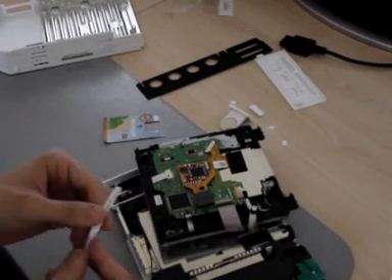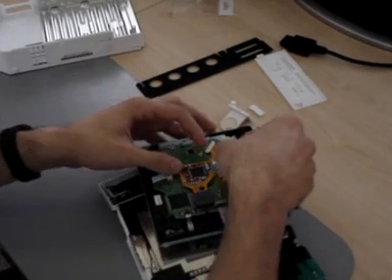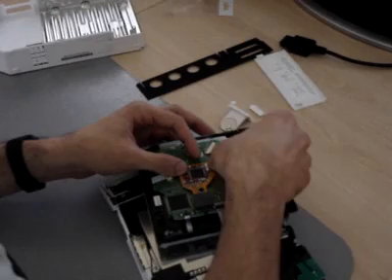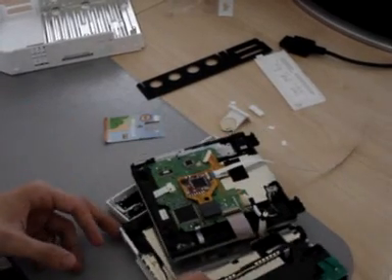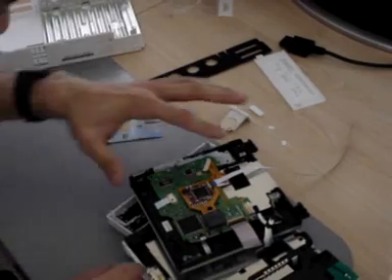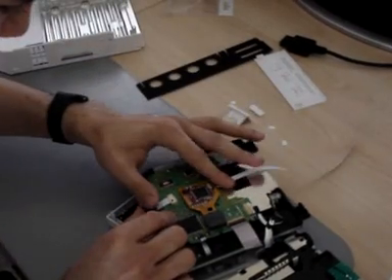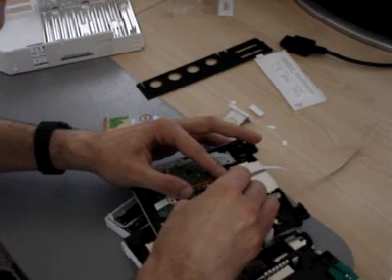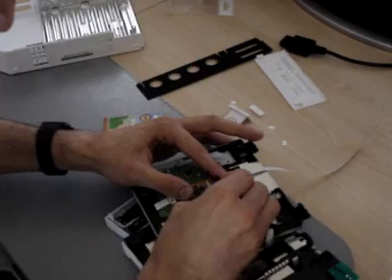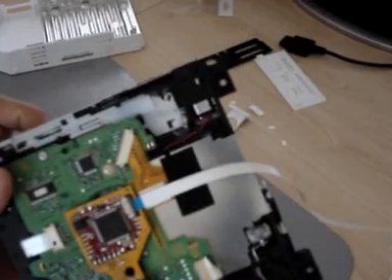Nintendo can't change the firmware of these chips via a Nintendo update. But it's kind of a just-in-case cable — just in case something really bad happens. You can always install it at a later date, but it's better to do it right the first time. You pass the cable into that little JTAG connector and then close it down. It just looks like that.